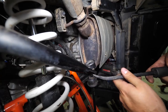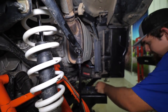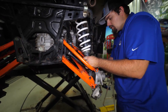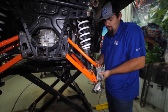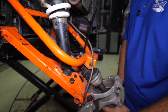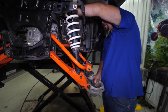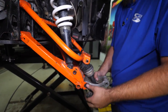This one's extra tight, so we're going to have to pry it off. Then we can grab our sway bar and get it out of the way, allowing our suspension to drop all the way out. We'll pull our upper A-arm bolt out that secures it to the knuckle, flip our caliper up into a good position so it's out of the way, remove our lower bolt, and remove the knuckle.